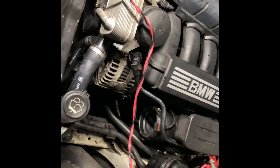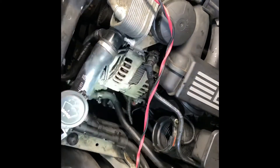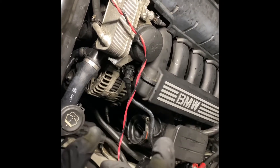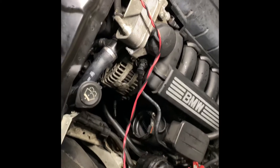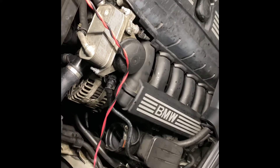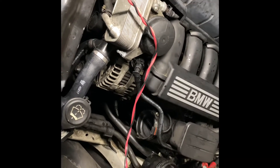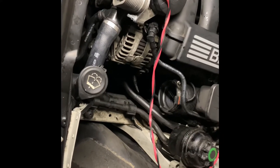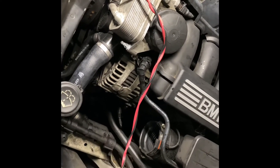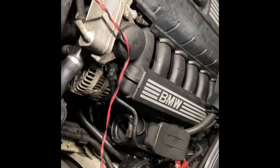If you're going to pay to maintain or just enjoy a higher quality vehicle, you gotta deal with some of those problems. All in all, this is the replacement of the upper radiator hose on a BMW 5 Series — it's pretty easy. You just pull those little clips and it comes right out, nothing too much to worry about. Some people have said to put dielectric grease around the O-ring on the inside — the rubber O-ring — to help with the seating. You can do that; it might be a good option for the longevity of the seal.